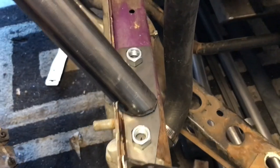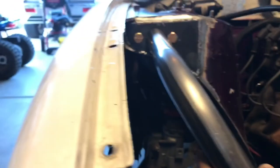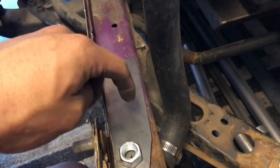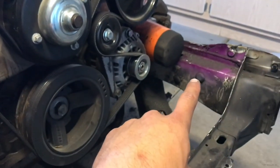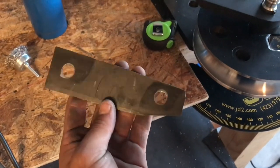After that, I put on my fender because I want my tube to be parallel with the fender. So basically it's going to be roughly like this — I trimmed it down to where it would sit fairly flush. My bolts will be going roughly right here. I did have to cut a little bit of this out. I want it to be completely parallel with the fender. Now I'm going to drill these holes, weld the nuts on the back of the plate, and drill the holes through this, then do the exact same thing on the other side.